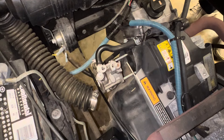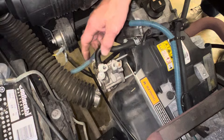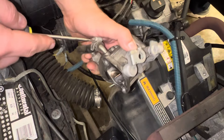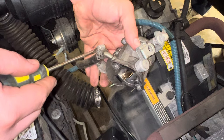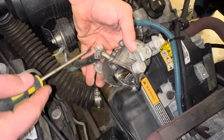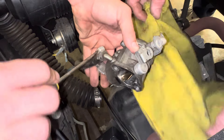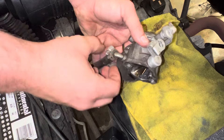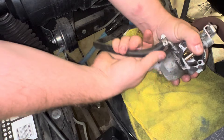Next, you want to get the fuel line cable off. I would pull the carburetor out first — it's easier to take it off that way because sometimes it's down there where it's hard to reach. The next thing you want to do is turn the gas line off. This car has got a fuel shut-off between the fuel pump and the fuel tank. I just turn it off so it don't leak gas. Then put a blanket or a box down there to catch any drips.